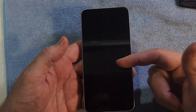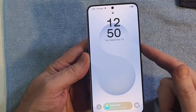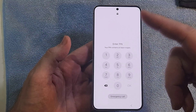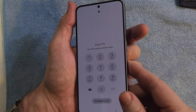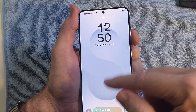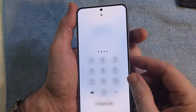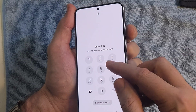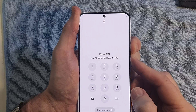If you're ready to reset your phone, let's get into that right now. To reset your phone, you have to power it down first, but it still needs your PIN, pattern, or password. So let's force it to shut down. We do that by holding volume down and power at the same time. I'm going to touch the screen so it stays on while we do this, as it gives us a visual cue. We're going to hold volume down and power for several seconds — 10, 12 seconds.